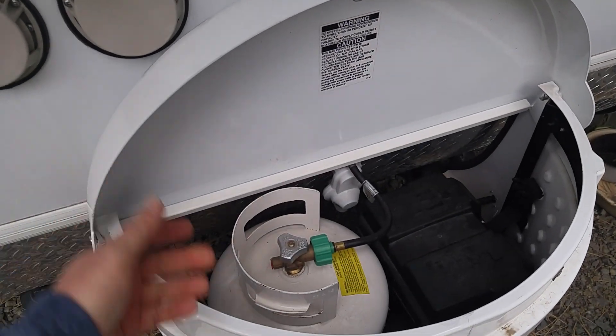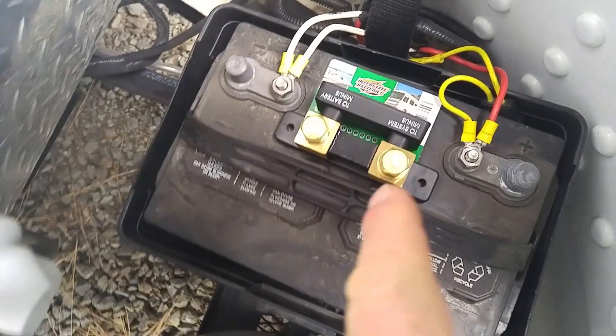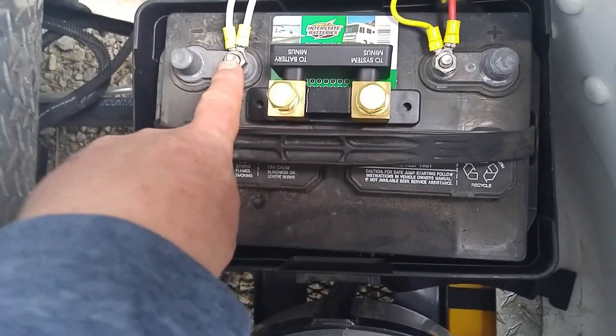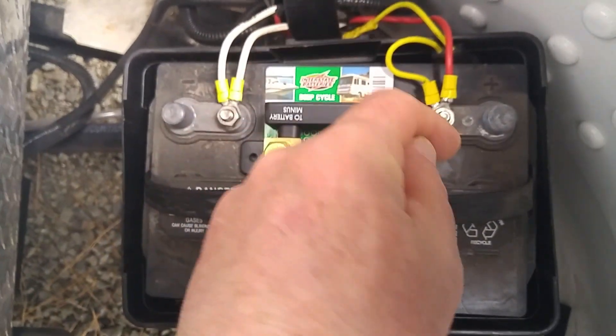Here we are out at my 2015 Max S trailer by Tab, inside my front bucket. Take off the battery cover — there are the wires. This is my positive leads, these are my negative leads. This is that shunt, and I'm going to install it right there. I have more than enough room in the top of the battery box — you can see how tall it is. I'm going to take all the wires on this negative lead, move them over here, connect this lead back to the negative lead. Pretty much that simple. Then we'll take a little red wire and connect from the positive here, and we're done.